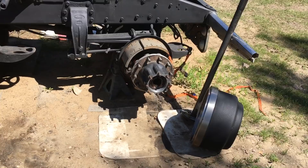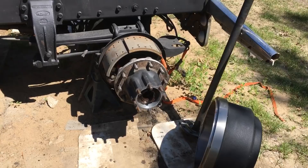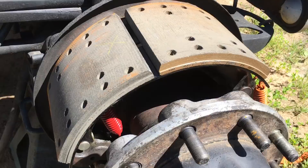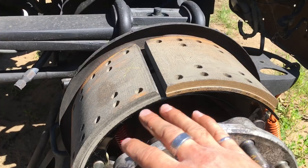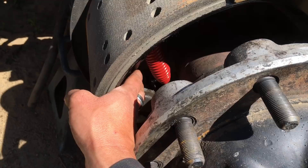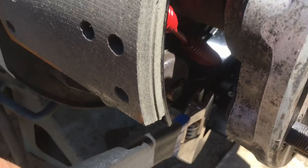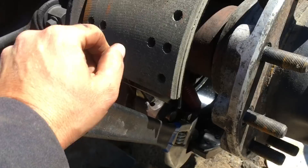I've been focusing on the brakes and the hubs. I want to make sure that everything's safe. As you can see, I've got new brake shoes on, new springs. A good trick I learned from another fellow YouTuber: you put on the top shoe and put on these two springs, flip your bottom shoe under — that allows you to click this on without any special tools. You leave the little wheels off and just use a simple crescent wrench to pry the springs and put the little wheels on. It's a nice trick to swap the brake shoes out without any of the fancy spring tools.